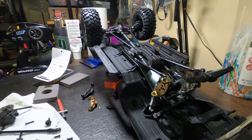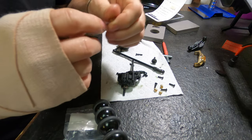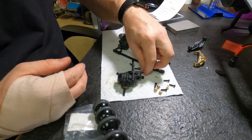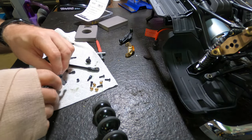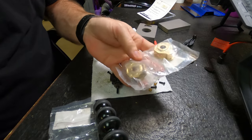We're going to move the GoPro over here. As you can see, we've got a fresh portal box. Now these will come with the new C-hubs, so you won't actually use these old ones. You'll actually use the screws that come with the C-hubs. These bushings actually go into the C-hub with the flange inward. So what we're going to do now is take this diff box apart and change the inner and outer — we're going to put brass on it.